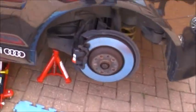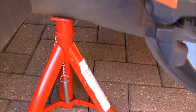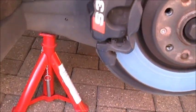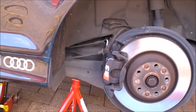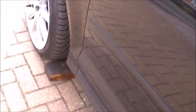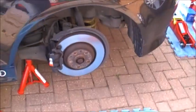As you'll notice, we've gone for the health and safety measures. I know we joke about health and safety, but this one I do use — I've seen cars collapse on people in the garage trade and you don't want a car on top of you because they're very heavy. Always get yourself an axle stand, and put it under as well as the jack. Also bear in mind that when you jack the back end up it's going to roll backwards because your handbrake's on the back end. Always get chocks under your wheels — I use wooden chocks — something fairly substantial to hold it. If it does start to roll, that will stop it. Always make sure you're safe.